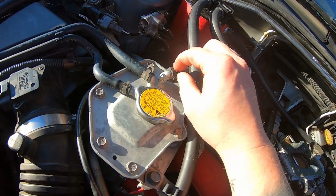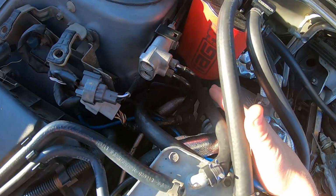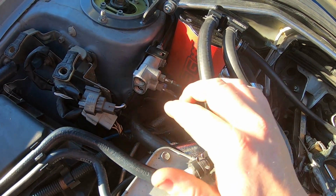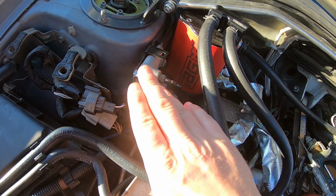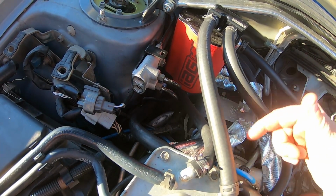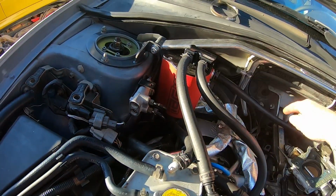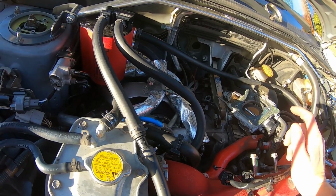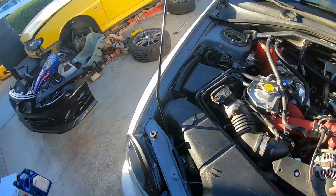Then you have your coolant lines. This is from the coolant line adapting to this, where the swivel joints are. This is your right-sided one. If you guys can see that, this one goes to the actual coolant reservoir, and then you have your turbo inlet, or turbo feed coolant, which feeds your turbo. This is going to be the left one. Other than that, that is basically it. We're just missing that one that goes right to the bottom side of the throttle body. I just have to throw that line in once I get the fitting, but other than that, it is pretty much done.